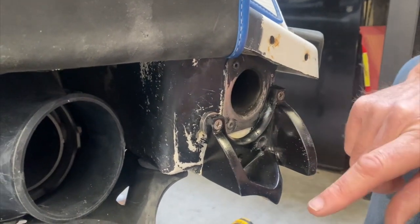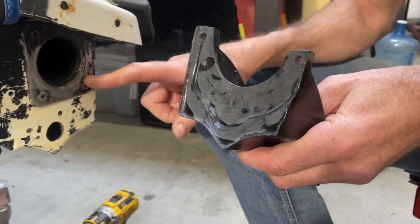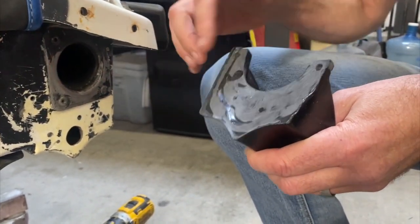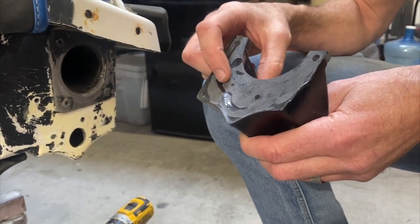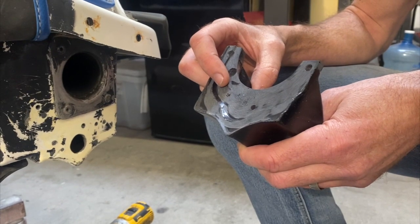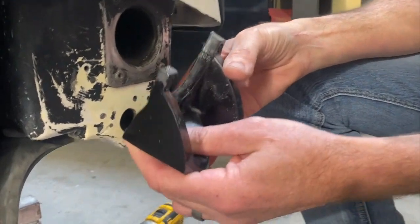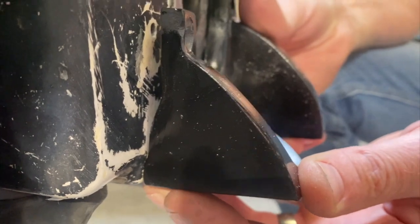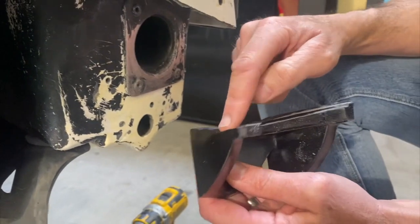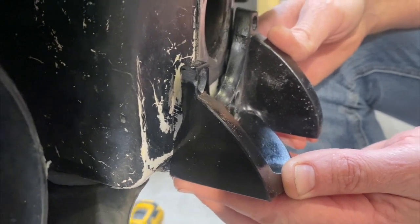Like I said, this is my personal ski. I'm going to show you how to install it. Here's a look at the hull extension for the exhaust side, and you can see that this shape here is not quite the same as the original exhaust. This actually fits the pre-07 SuperJets. When you go to put this on, you're going to see that the gap is too much. But we're going to install it with a few washers, fill the gap with silicone because that works really well, and screw it on and you're good.